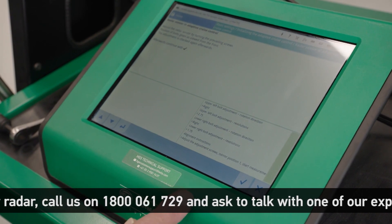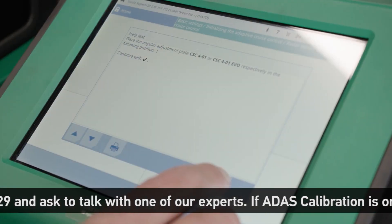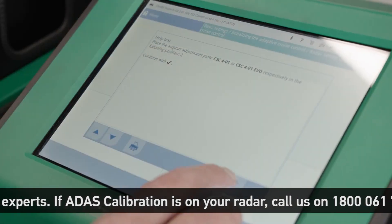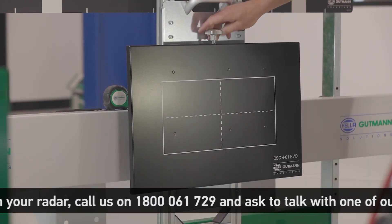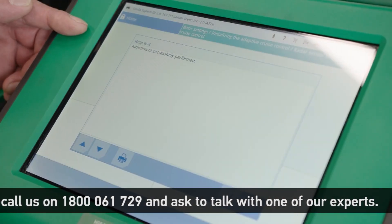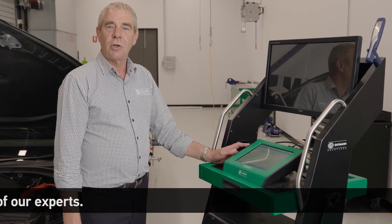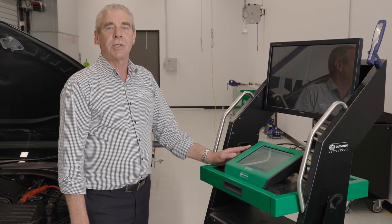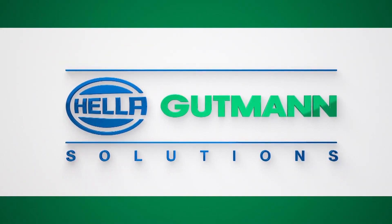With the advised adjustments made to the radar sensor adjustment screws, we return the radar plate to position 1 and continue. Now to position 3. Here we can see that the radar calibration has been successfully performed. The calibration results are stored with the vehicle history and can be referred to at any time in the future. That concludes this video. We hope you enjoyed it and I look forward to presenting the next video where we will conduct a front radar calibration on a Mazda 3. We'll see you in the next video. Bye.